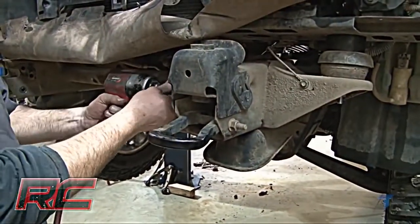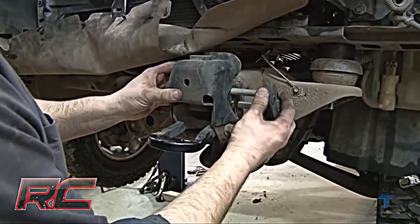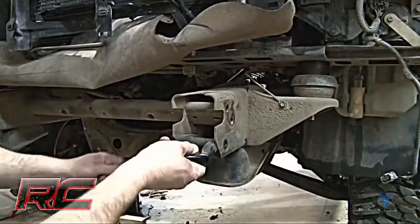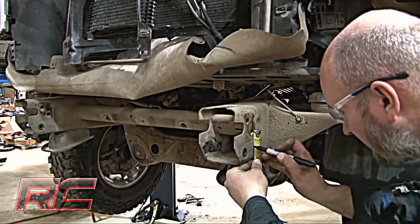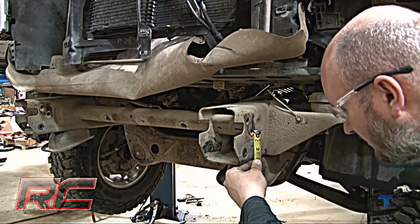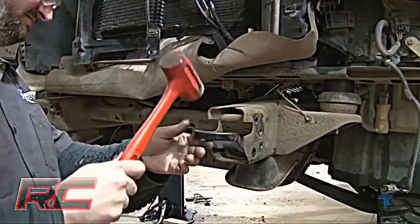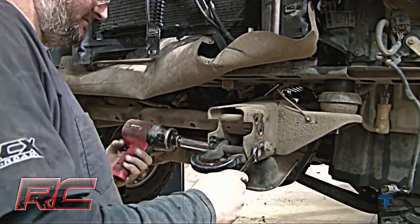Remove the 2 bolts from the driver and passenger side front bumper brackets. Retain the stock hardware. Mark the front tow hooks as driver and passenger top and remove the hardware. Measure 1 7/16 inches down from the second bumper mounting hole and mark. Then, drill a hole using a 1/2 drill bit. Install the tow hooks so they are upside down and install the stock bolts.